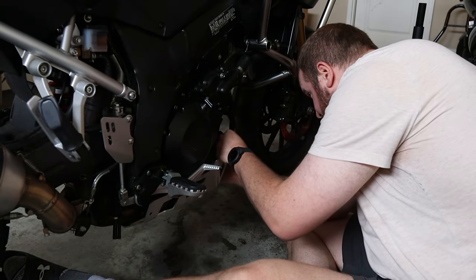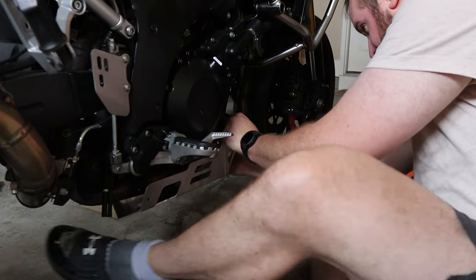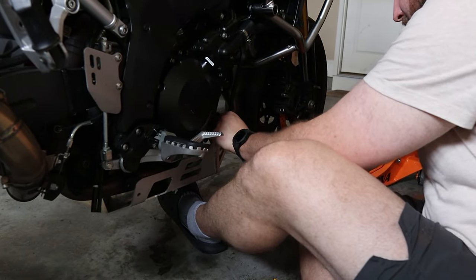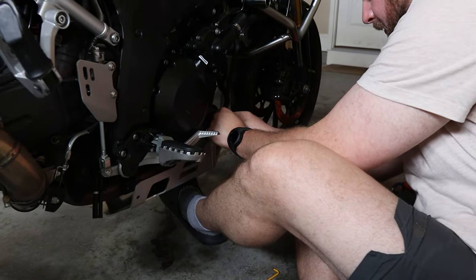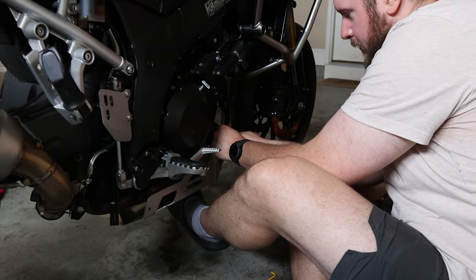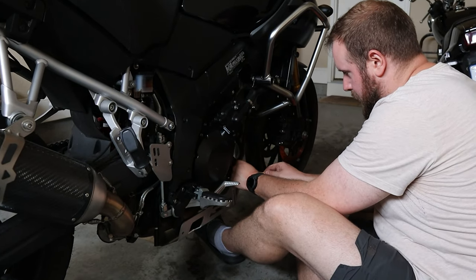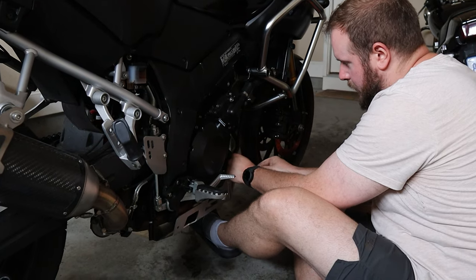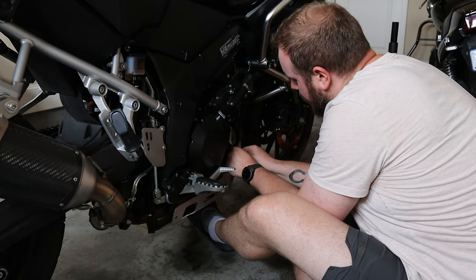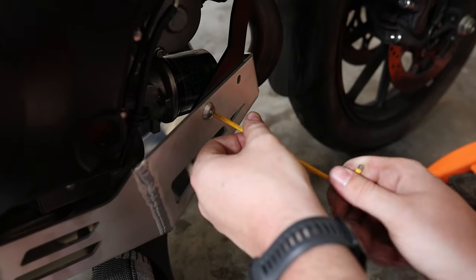And the nice thing is these are slip bolts here. So I'll try to fit one of these on. Actually, it's easier. There we go. So what you want to do is just be careful with these that you don't cross-thread them. So you want to kind of spin backwards, as if you're removing the bolt, until it falls into the thread, if that's even going to be possible. So again, you don't want to tighten these the whole way yet.